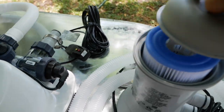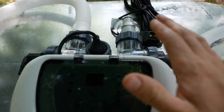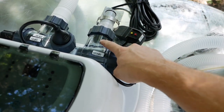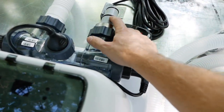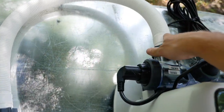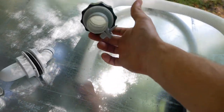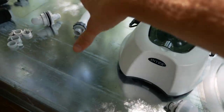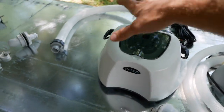There's your filter. From there it goes into this saltwater chlorinator. Now this thing receives inch and a half tube so we've got an inch and a half to an inch and a quarter reducer and that comes with this, which is great. From there we've got inch and a half tubing which actually goes back to the pump right here and that is going to complete our basically water filtration system.